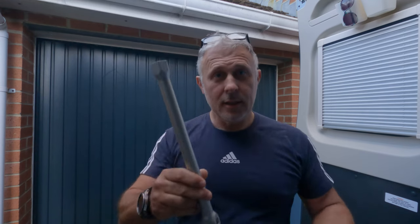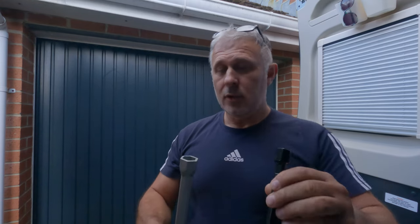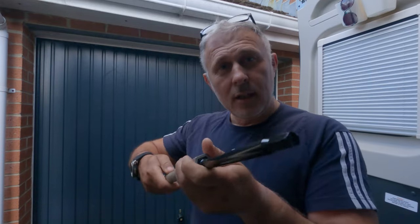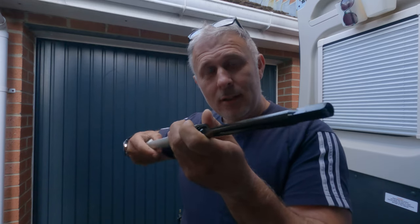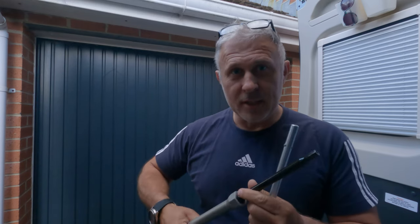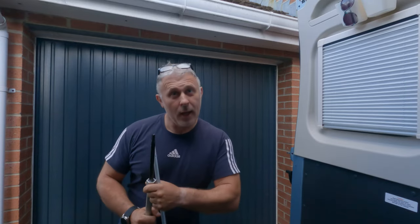You've got your toolkit from under the seat and you're going to lower this wheel down from underneath the van using these tools. First of all slot that into there, then you're going to use this to wind it anti-clockwise to lower the wheel to the ground. You may need to use the bar if it's tight, but it should loosen by hand if it's new — though it could well be stuck if there's a lot of muck under there. This can be quite daunting if it's the first time you've done it, especially if you're out in the dark and it's raining.